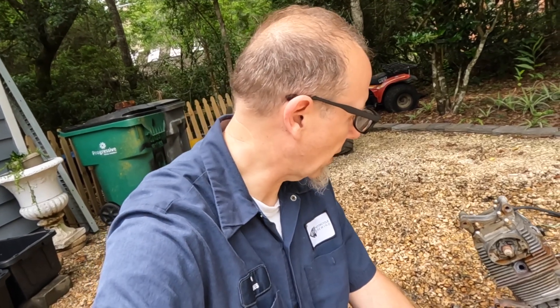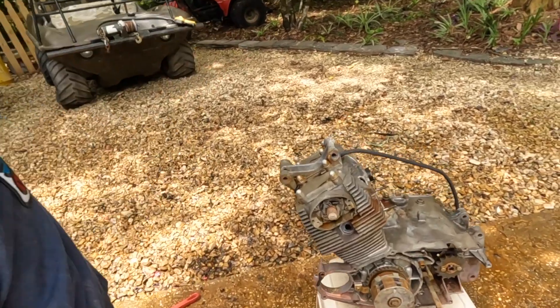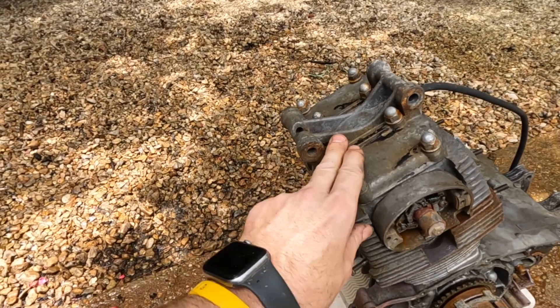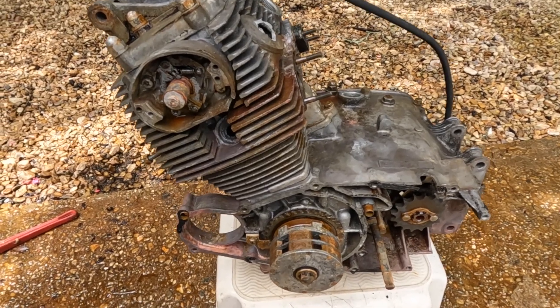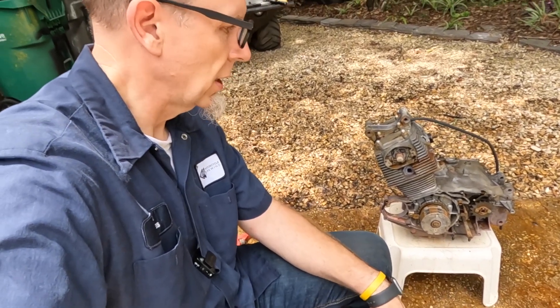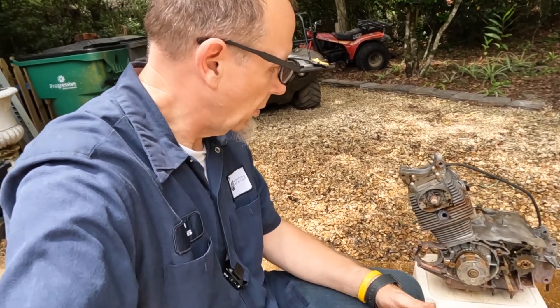Okay guys, first week of soaking the CB160 engine in 30% vinegar — I'm going to say it's not a total failure. The engine's still not free, but again, I wasn't expecting it to be free yet. Everything does look a little bit better. One thing about using vinegar is it'll start to flash rust right away. I'm going to put it back in the juice. I'm going to go get some more vinegar so my level gets up a little higher, and I'm just going to go with normal vinegar — not 30% vinegar — just because it'd be way cheaper. I think most of the heavy stuff is gone, and then we're going to let it soak some more.